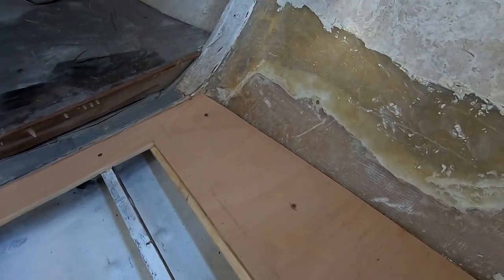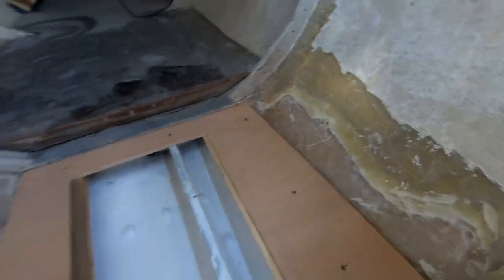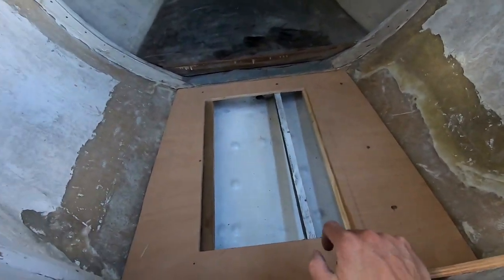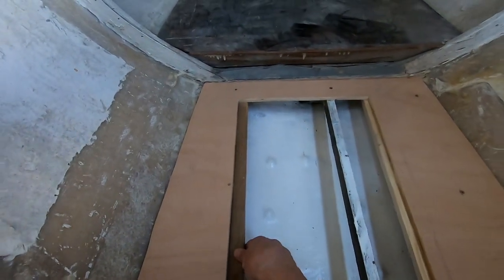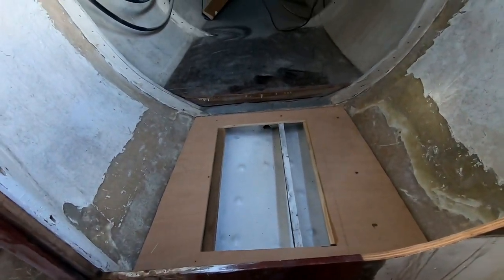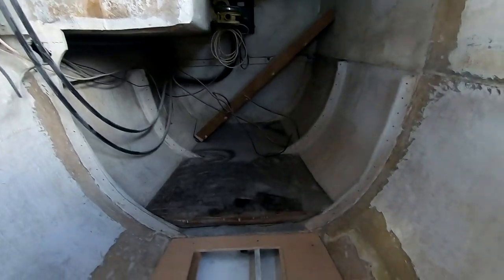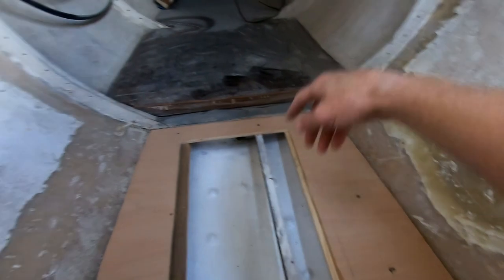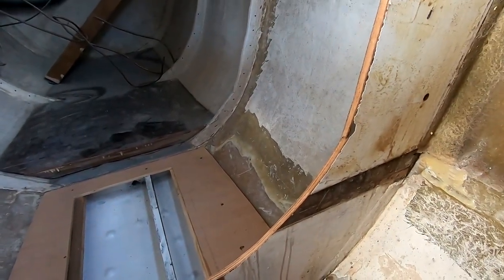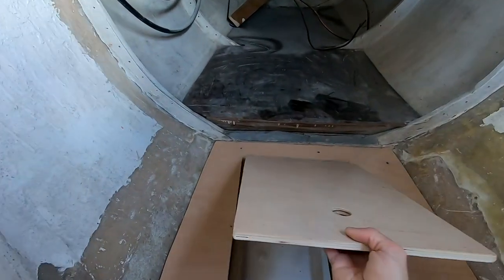Trouble is, a lot of the epoxy that I was squidging it down with on the actual piece has gone to rats. So I'm just going to finish. I've packed this out to make it the right height to get rid of the high bit on this beam here. So if that's all good, I can then move on, fit in the bulkhead, and then I'll get the gaps filled in, do the tabbing tomorrow, and it'll be good. Let's see if this goes in all right.